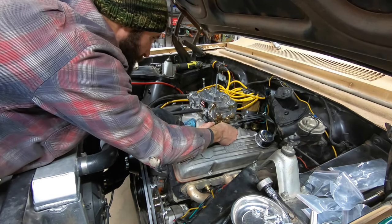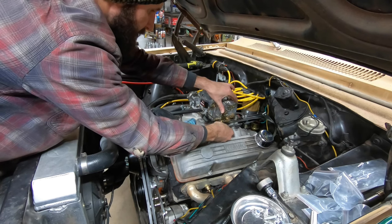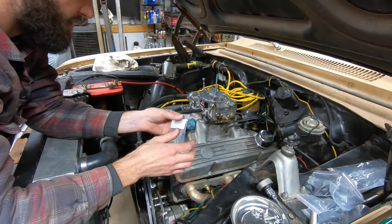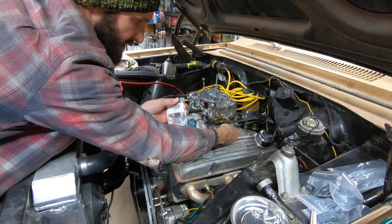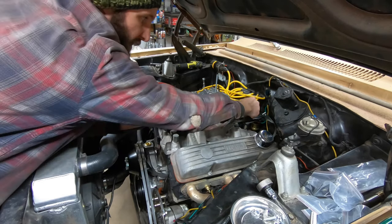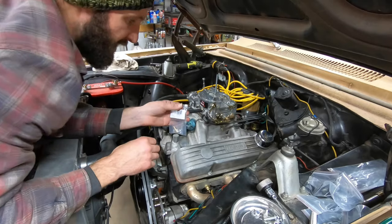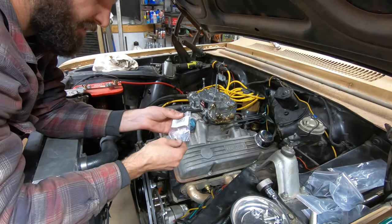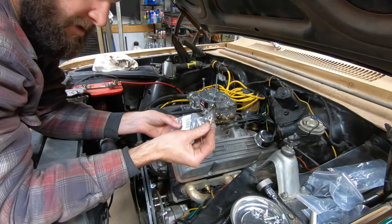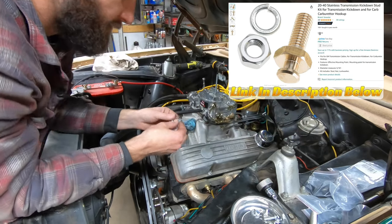Oh, just about perfect. Yeah. Okay. Now, once I get the stud in, this is connected, we'll have to do just a little bit of adjustment, and the whole bracket's gonna have to come back out so I can cut the back of this off once I get it adjusted and know how far up I can cut it. But the one other piece we still have to account for here is the actual little stud for the kickdown. The stud that the kickdown clips onto is not included with the bracket assembly. It's a separate item, which I think is silly.